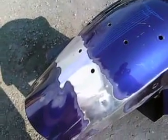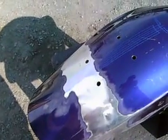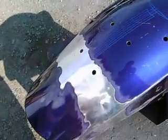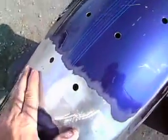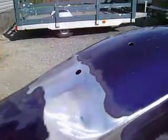Travel every couple of inches, tack it, another couple of inches, tack it, let it cool, and then move over to the next tack, every two inches. Allow the metal to cool, don't allow it to get too hot, and you will get this nice — this is smooth, this is not warped at all. It's hard to see on camera, but this metal is smooth. I didn't warp it at all, I was very, very patient.